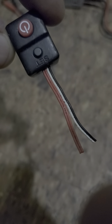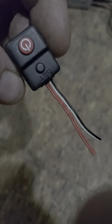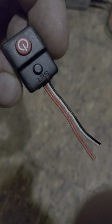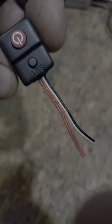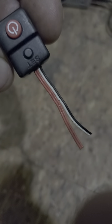I wanted to share this because if you look in the back of the power button, there are two screws and a motherboard in there that sends a signal to your ESC. It also interferes with your programming once that motherboard gets damaged. You get glitches, speed errors — you could be doing 50 or 60 mph and feel the power starting to bog down. That's caused by this switch.